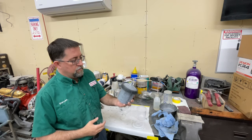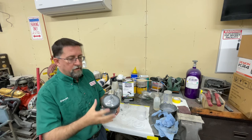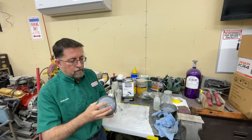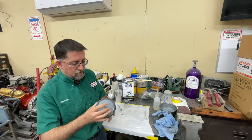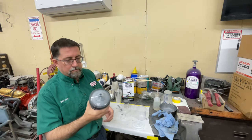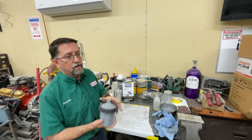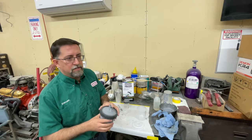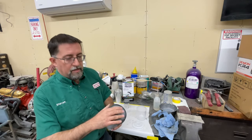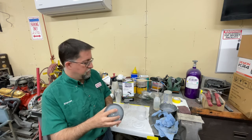This one on here is what I've been using for primer — I still have some material in there. What's nice is you can cap it off; you don't have to pour it into another container and put a lid on it. You just cap it off if it's going to be a few days before you use your paint again. Obviously that's not going to work with anything that's been catalyzed — this is epoxy primer and it's already super thick. Some materials have like an eight-hour pot life, so once you put your catalyst in, you have eight hours to use it. Check your data sheets and it'll tell you exactly what you can do.